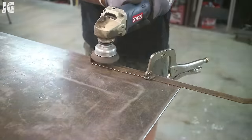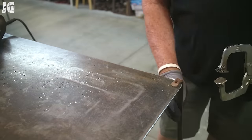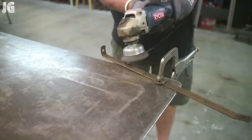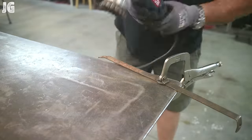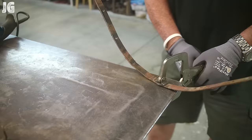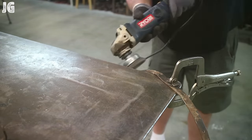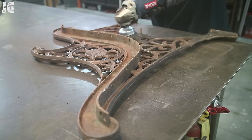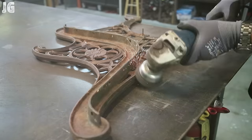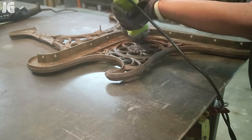For those rusty old nuts that wouldn't come off, that was no challenge to my cut-off wheel. I got in there, cut those off, and took a chisel to what was left — and it all came apart fairly easily. Once everything was apart, I cleaned up the residual mess and laid the metal sides and bracketry down. I took a wire wheel and cut the rust off everything I possibly could. Much to my surprise, it cleaned up pretty good — everything was in pretty good shape. One bracket was bent but I was able to get it bent back into shape.